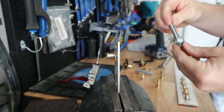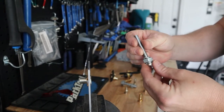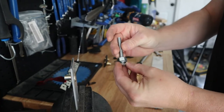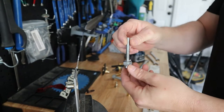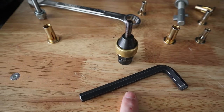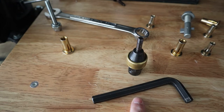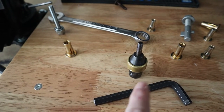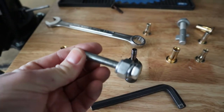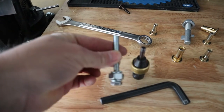One tip: a lot of torque is applied to these bolts, so if you go to the hardware store and get a grade 8 or class 10 bolt they last a long time. If you're having problems with stripped threads or bolt strength after a few uses, try a class 10 or grade 8. If you're doing thousands of these a day, a pneumatic or hydraulic press tool would be more appropriate — but for a van build with occasional use, this DIY solution works really well. For different size threaded inserts, just buy the matching hardware at a local home store for under two dollars.